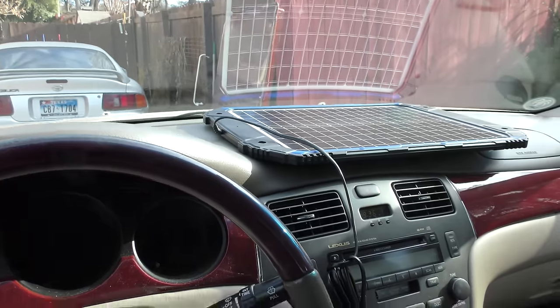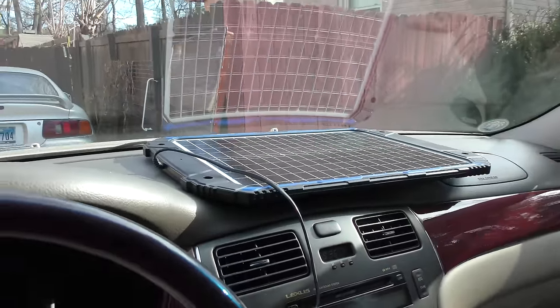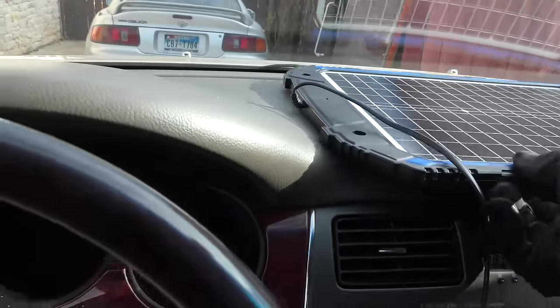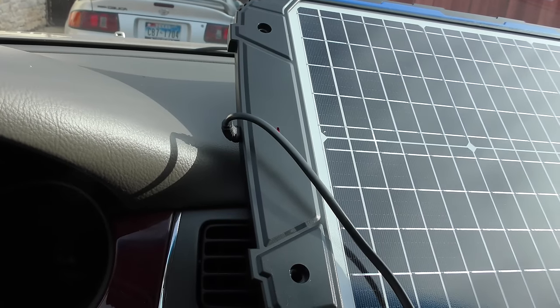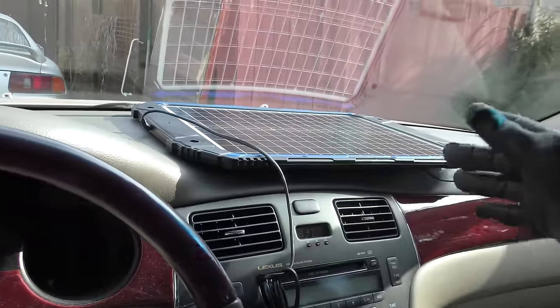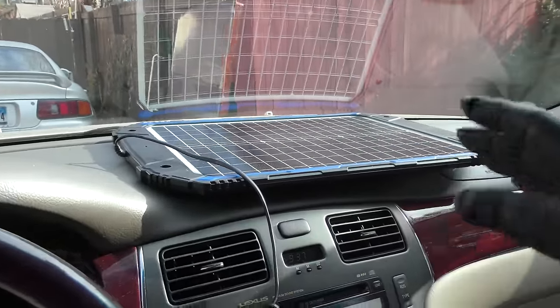This system is set up so it won't overcharge — it's maintaining your battery, giving it a little bit of trickle charge when it needs it. This thing sat for months and now the car runs, but it's not fully charged because it sat for such a long time. This is now fully charging it while it's sitting in the sun. You can mount it wherever you want, put it in the back, and this thing's waterproof — you can even put it outside if you want, but then somebody might steal it so it's safer inside the car. While it's flashing on and off, it both trickle charges and float charges the battery, which will increase the lifespan. Batteries like being charged slowly, and being that it's a relatively small solar panel, it's not dangerously overcharging anything — it's just gradually keeping your battery up.